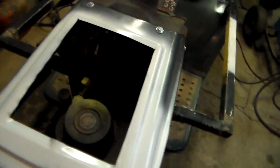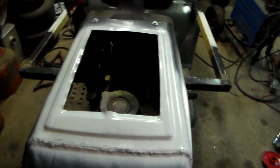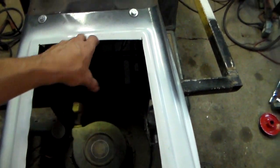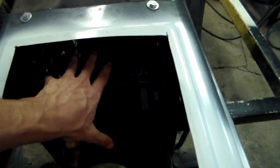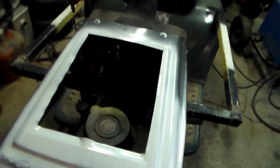And something I do that no one else does, I cut a hole out on the top of the hood. I do this for multiple reasons. The first main reason why I cut the hole out, sometimes it's just a small hole, but I've been starting these big holes. Makes it so much easier to get to your oil. Makes it easier to get to your gas tank. I can also get to my pull rope if I need to. I can also look down here, watch my engine, see exactly what it's doing, and see how far the hood's coming in. So it serves a lot of purposes.